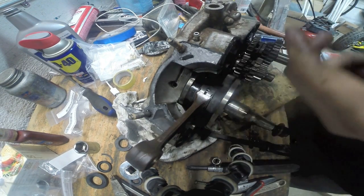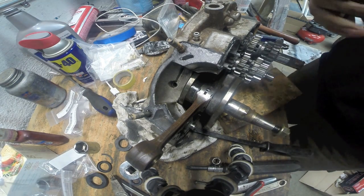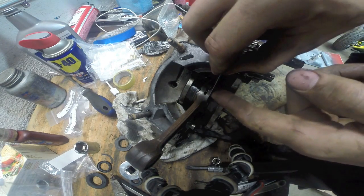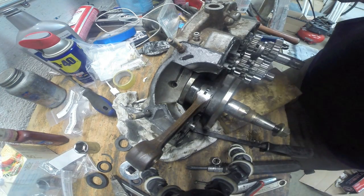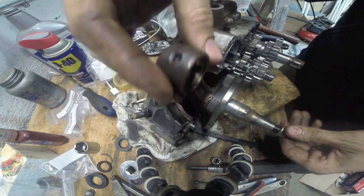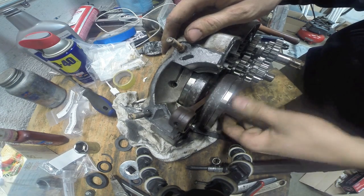You're going to move the crank back and forth until you feel a slight drag. I was at 22 thousandths, 25 is too tight, so we can try 24 thousandths and see how that feels. I have a hard time getting 24 thousandths in, so I would say we probably got 23 thousandths. The crank is still good — we're on the bad end of the spectrum, but it's still good. The crank is good to go, it is not out of spec, thankfully, that would be an added cost to our rebuild.